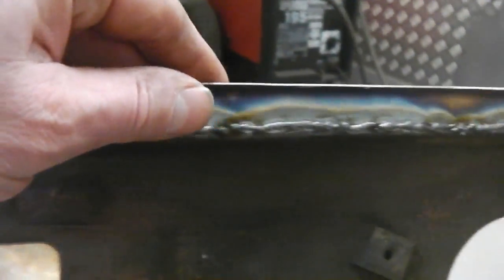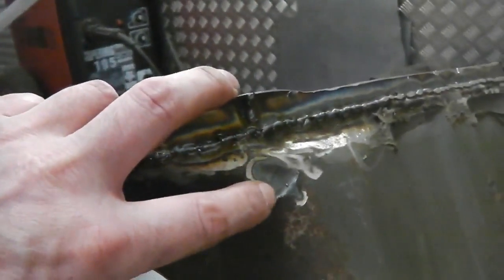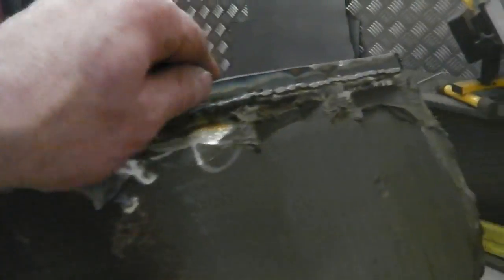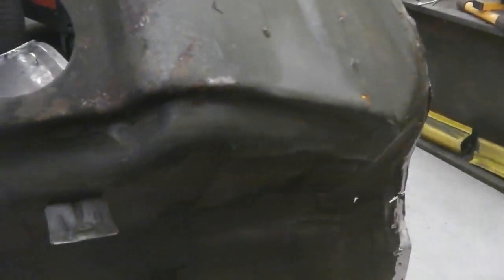Had the welder wire speed set down low on position one. There's a grinding scuff there where I caught it chopping it out. I'm gonna have to fix that. I've thinned that metal, that must be repaired, mustn't forget. Some welds to dress up. All in all, it's solid. Just needs cleaning.